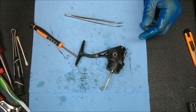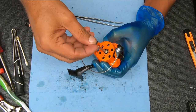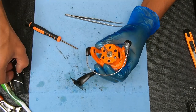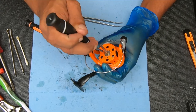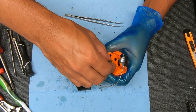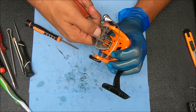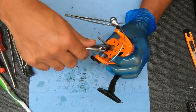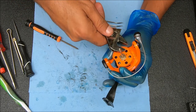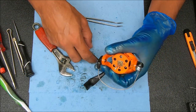Now we can take our rotor and stick that back on there. Add our little washer or plate, then we're going to screw that down — oh, it's lefty-tighty on this one. Line that up to where I can get access to one of those holes. I don't want to over-snug this because I don't want to damage the pinion stack — meaning the bearing in there.